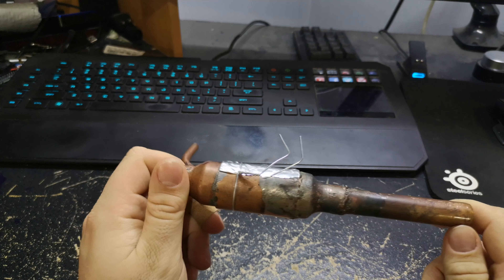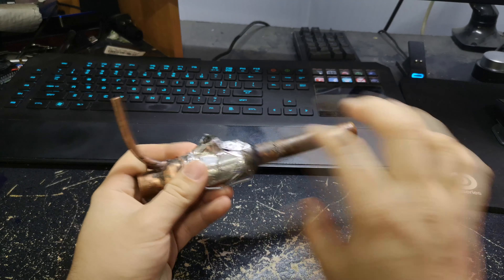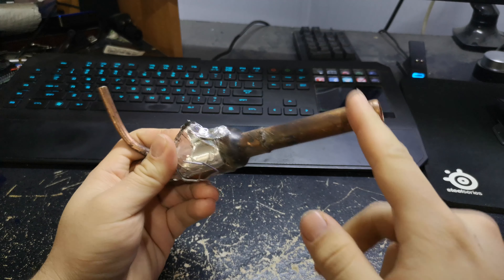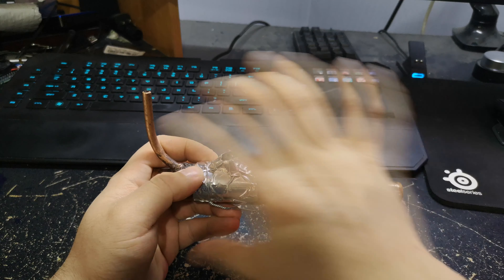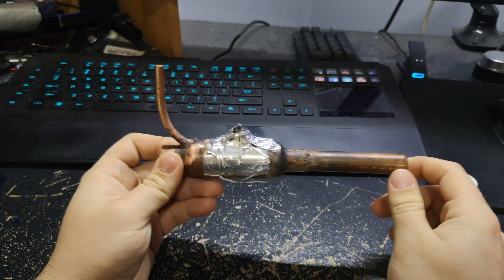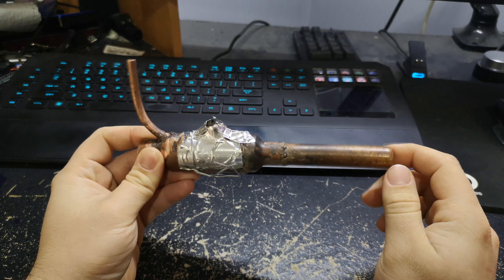One quick additional note: people might not use copper because it overheats. An idea I had is to have the intake loop around and — like an air-cooled machine gun — have an exterior shroud that all the intake air comes in through. You'd have a barrier with holes at the end of the exhaust pipe, then one size up copper tube around it, so as the engine runs the intake air would potentially cool the system and keep the copper from self-destructing.